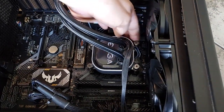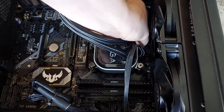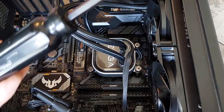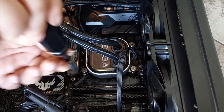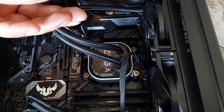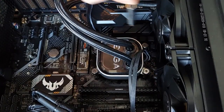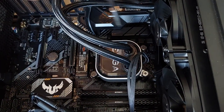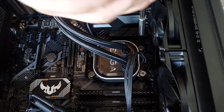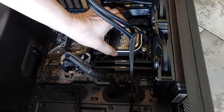This is what's supposed to happen when you press it down — if nothing happens then something is wrong. Don't tighten too much. Use the screw driver — an anti-static one — and tighten in a cross pattern. It's very important to do it in a cross pattern; that's the best method to ensure even pressure.